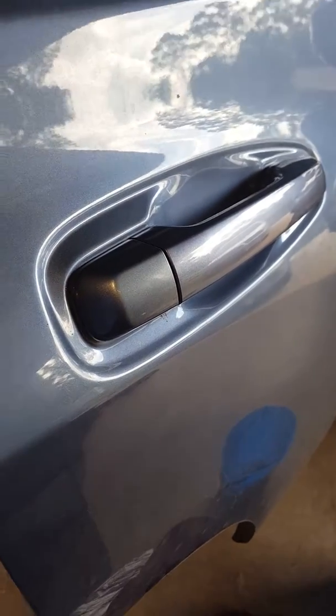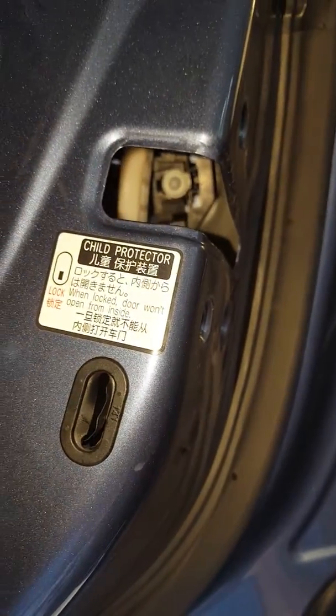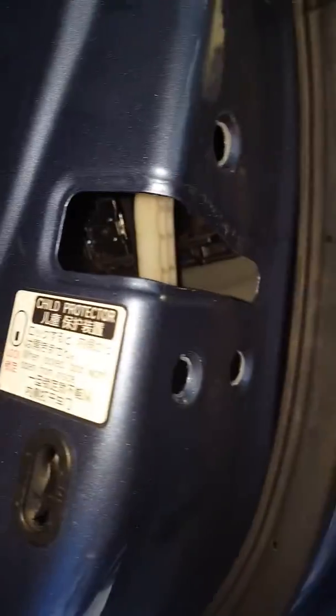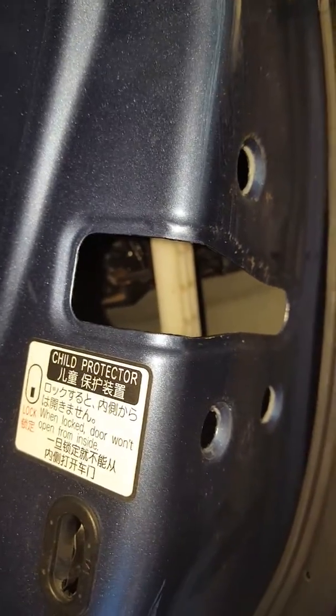So the door cover has now been installed. Basically, by putting it in place with the one little clip on the end, which you may see to the right of that star headed screw, which is a T30 — very simple. So basically after that now, the door handle is fully installed and working. We just now need to install the latch where it actually closes and we can lock it all.